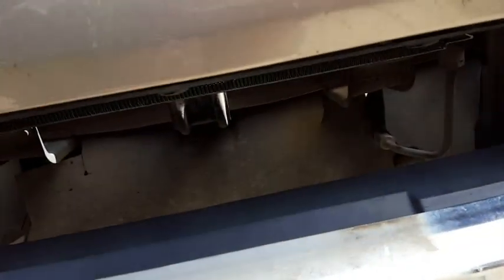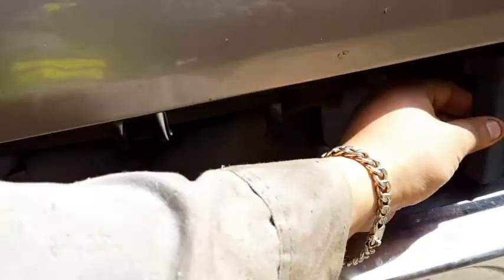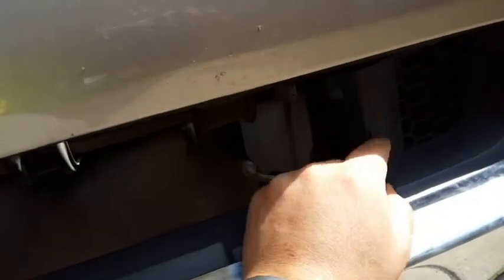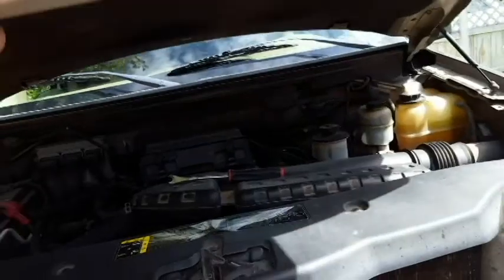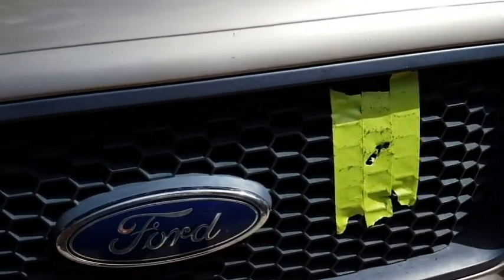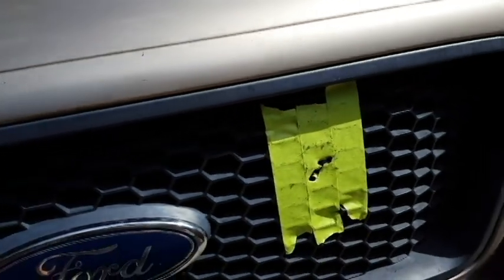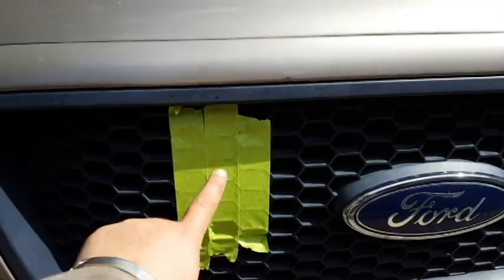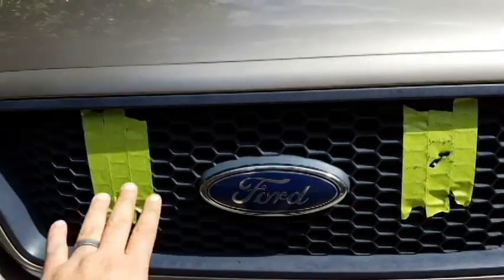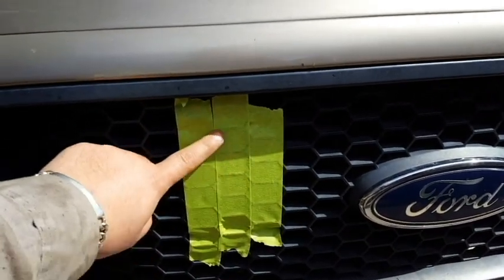Now I'm going to bolt up the light bar in place first, then trim the plastic pieces a little at a time until I get a nice snug fit — it pops back in with a little notched area. For the top lights, I set a marking point by taping up the little honeycomb slots, tested the Dremel to make sure I could get a cut, and now I'm determining exactly where I want them width-wise and height-wise.